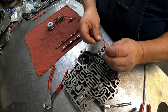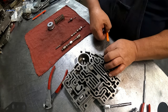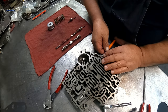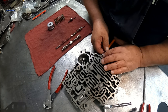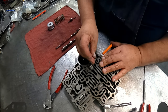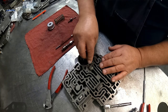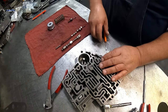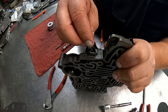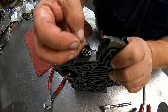All right, the roll pin's gonna go in between here. It's gonna hold this valve from coming out. I don't need to shove that thing all the way in there. Just needs to be flush. This is the adjustable type, so this spring goes around the tip of that valve that's sticking up there. The pointed end faces out,